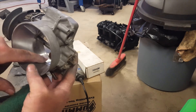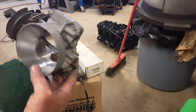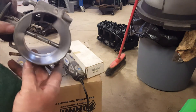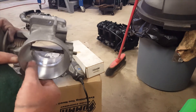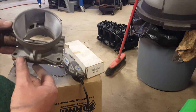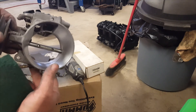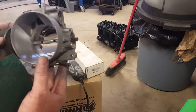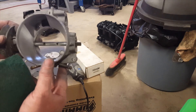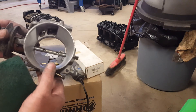This watermark back here - this throttle body was all white and had been sitting outside on top of an engine. It's stained. Because that's where the throttle blade is, I don't really want to come in there. You can see in here that we've radiused quite well - it's nice and smooth, a nice transition. I'd like to work that area a little more but because the throttle blade's in there, I'm just not going to. This should help - it got rid of the really crusty watermark and it's directionally better and a lot smoother.